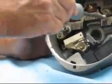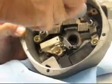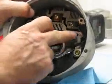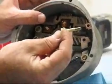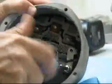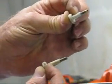We take those two ground screws out. Now on the positive portion of the bridge rectifier, the screws need to be insulated. There are two insulated screws on the left side and two insulated screws on the right side. Notice that the insulator on the right side of the bridge rectifier is the longest one. There's also a screw going through the voltage regulator — that's another insulated screw — and it uses a shorter insulator. So you have to make sure the long insulator goes through the bridge rectifier and the short one goes through the voltage regulator.